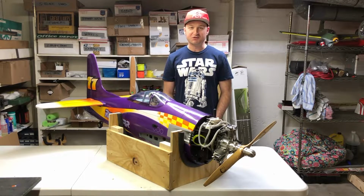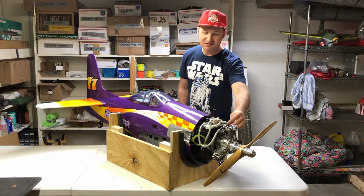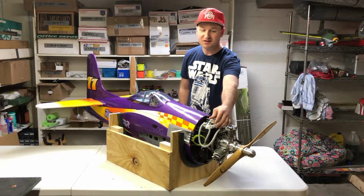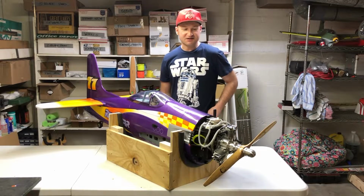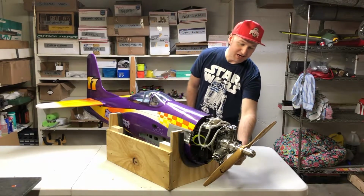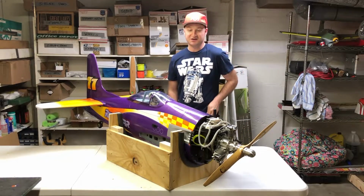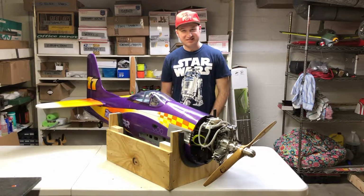You'll notice about halfway through the break-in video that I shut it down and disappear for a few minutes. That's because the plastic spring wrapped around the spark plug cables was resting on the exhaust ring, and it actually melted. It doesn't hurt the actual cable itself, but it did smoke and smelled pretty bad. I also had my nipple drain on the bottom touching the exhaust, and that melted to the exhaust as well.